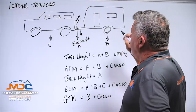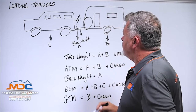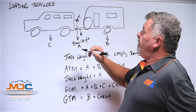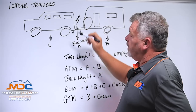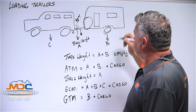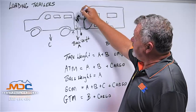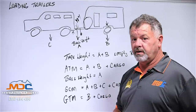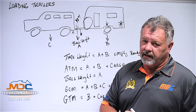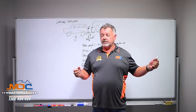But how do we achieve that? Often most of the storage in a caravan or trailer is going to be in the front section. So it's very easy to go beyond that ten percent and start getting some ridiculous ball weights. You have to keep in mind what the ball limit is on your tow vehicle from the manufacturer. Now if we're starting to get a bit heavy, what we want to do is load the weight above the axles — get as much weight as we can above the axles while still achieving ten percent on the tow bar. What you don't want to do is start loading too much weight at the back of the caravan, because that's going to create a pendulum effect.